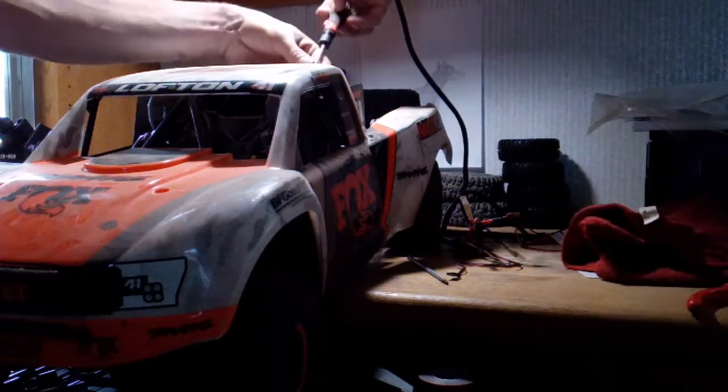I'm going to take this plate off right here, see if we can't get to it that way instead of taking all this stuff out from inside. Another thing — this battery tray cover or protector, this thing sucks. The rocks get in here, it makes it hard to slide this thing out. Fair warning guys, if you get this truck, the tray when you drive it in sand or real fine rock is going to jam up your battery protector slash cover, because it's a dumb slide-in design.